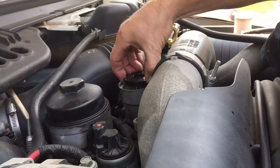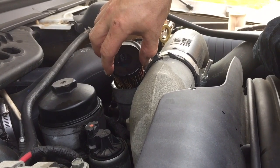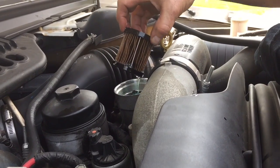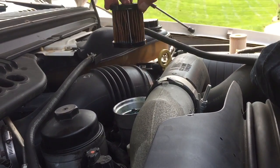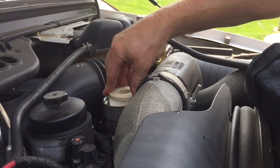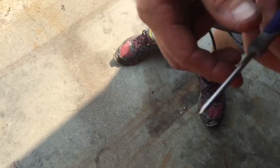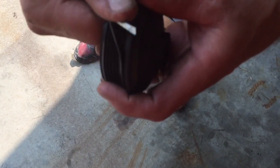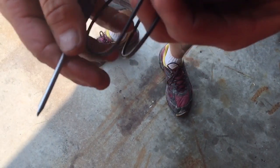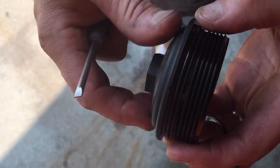So now I can take my fuel filter out — there's still a little bit of fuel down in there. Once I get that out of there, I can go over to the new one and slide that right in where it goes; it's a little spring-loaded there. Now on the cap, you want to replace the O-ring. It does come with the replacement O-ring, so I just take my little screwdriver and take the old one out and put the new one in. Put it in the slot all the way around — make sure it's in all the way around.